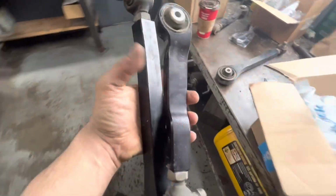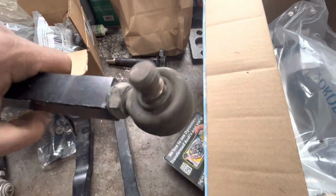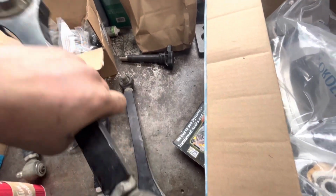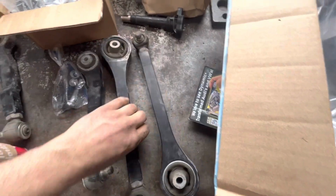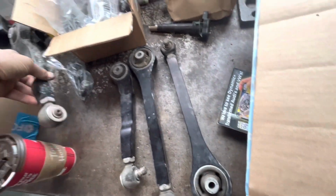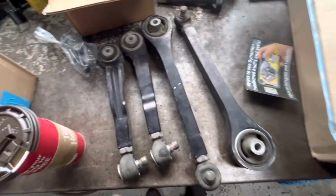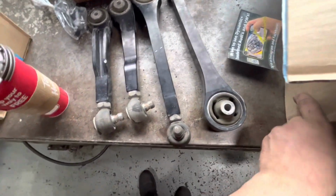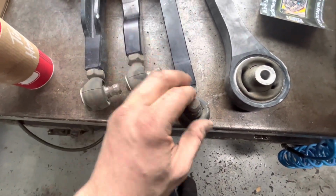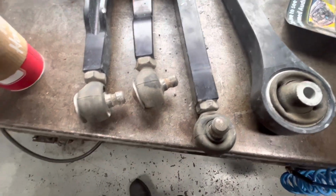They're really high quality control arms, and they have these ball joints there. It's a booted Heim joint, so it's more of a for race applications kind of thing. And I wouldn't recommend these for a daily driver, something that's just driven on the road mostly. This would be better for a car that was a track car that occasionally went on the road, but these don't hold up as well as standard ball joints. They're all loose, every single one of them, and they're creaky and noisy, and even with the boots, they still just don't last quite as long.